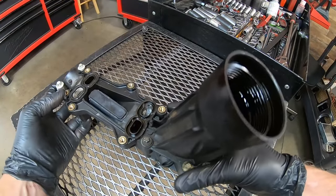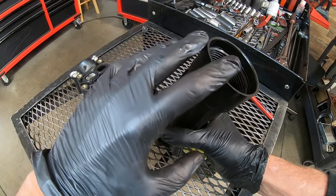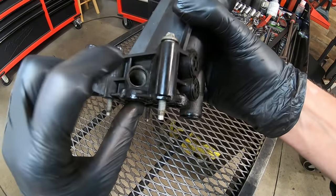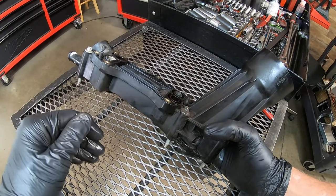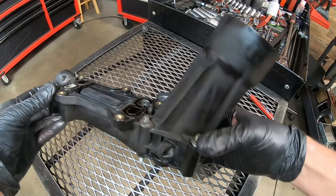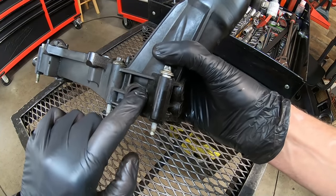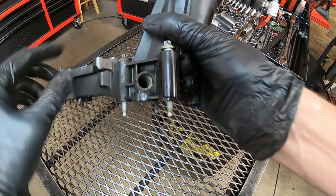I'm going to show you one that failed recently and why going to a metal design would help. This one came off of a 2014 Jeep Grand Cherokee. I've got the cooler removed and the oil filter cap because those got reinstalled on one of the Dorman replacements. If you look real close here — remember I told you to pay attention to those block-off ports — we've got one missing. It was the whole reason for replacing this. We had excessive coolant loss. It was getting into that area under the intake and coming out the backside. We pressure tested it and removed the upper and lower intakes so we could see where the coolant was coming out. This literally had blown out. It's not threaded — somehow that port is either glued or bonded by some means to the housing. The weak point was it blew off.